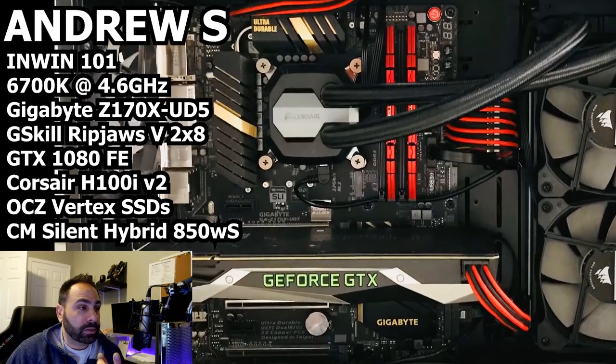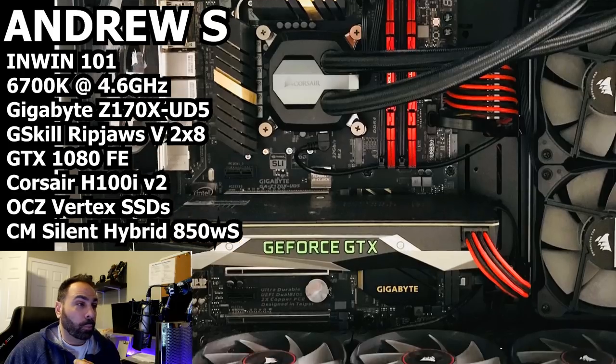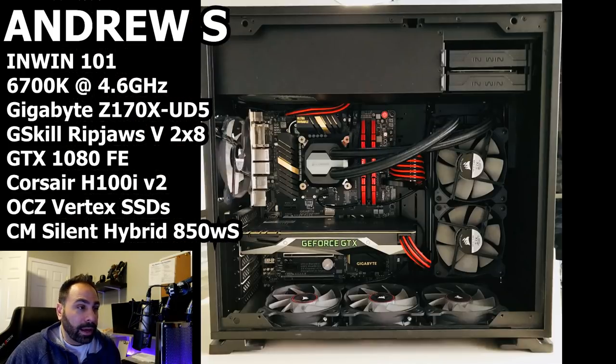The first is this cable coming off of your Corsair AIO. I know it's a necessary evil if you want to use Corsair Link with those AIOs, but I actually never do — and the very specific reason is because of this cable. It's kind of a pain because of how it comes down and there's a hard bracket you have to use to plug it in, and it looks really awkward. What I'd recommend is taking this cable and instead of bending it that way, follow the path it takes you — go underneath the bracket, route it up next to these chokes, then out underneath the heat pipe and find something to do with it up here. It'll make this a whole lot cleaner.